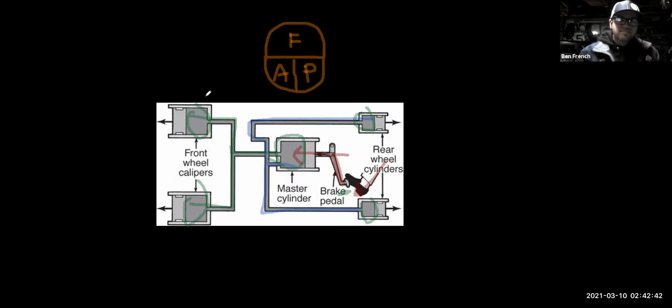And once I know the pressure, I can go back to the force applied on the brake pads themselves. So basically, the engineers who design our cars use this formula to figure out how much brake force they want squeezing the brake pads in the front and squeezing whatever brake system we have in the back, whether it's discs or drums, as well, okay? This isn't something we typically change as a mechanic, but it's in there behind the scenes to give the vehicle the right braking feel they were after.